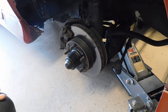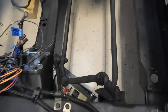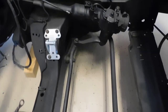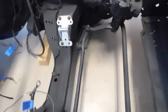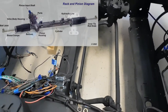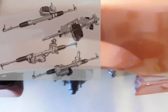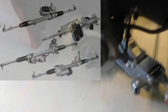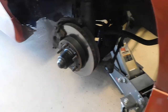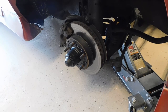Also keep in mind that this is a parallelogram steering system, which isn't really used anymore. Now they either use a rack and pinion — I'll post a picture of that as well. And a lot of newer vehicles also have electrical power steering, which is basically just a motor that operates the tie rods and turns your wheels. So that could be a bigger issue if you're having power steering issues. But if you have any questions on that, please let me know.